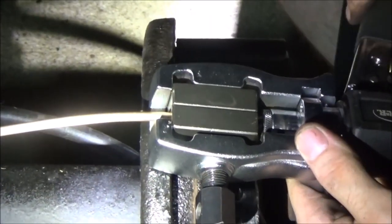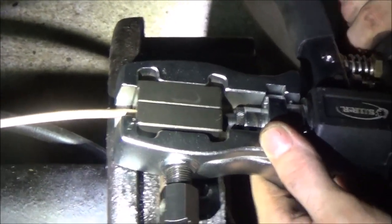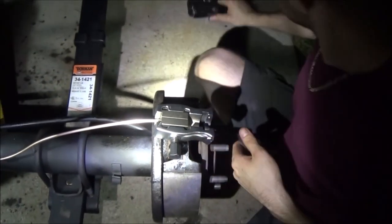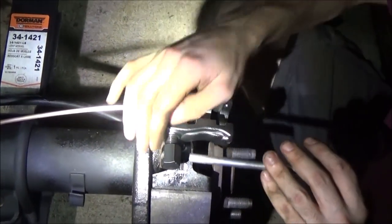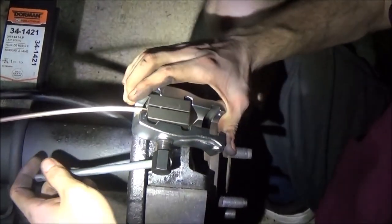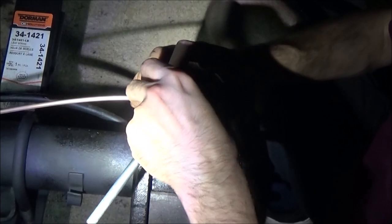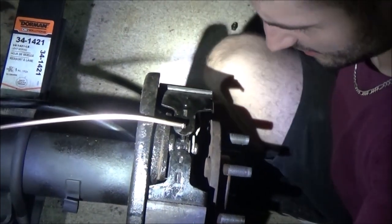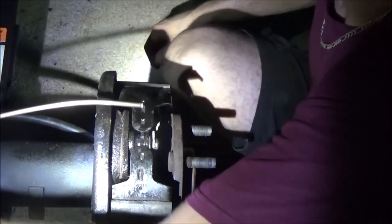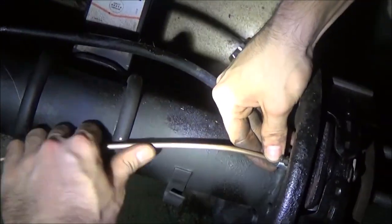One looks like a bubble, and the other one you have to make a bubble flare before you can flare it again. I've made double flares by using just flaring it once. Yeah, but it's tricky. I've used this tool to do it, and I just don't think it creates a satisfactory result. You gotta move it. Give that material a chance to move two times instead of all at once.